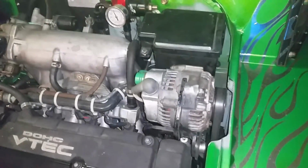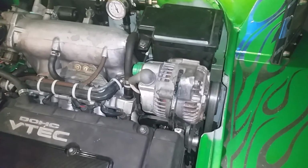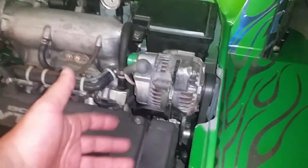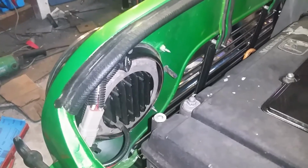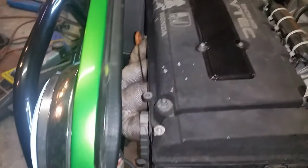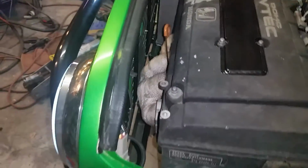The alternator, this is actually a Minitech alternator bracket, sorry, out of the States, and we've had to modify it a little bit to make it fit, but yeah, that does a good job. And as you can see, we've cut out the guard here to make room. We've got LED lights for obvious reasons. They're really thin. The mini headlight buckets came into about here, so there was no chance they were going to work, and even the headlights without the buckets were extremely close.